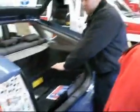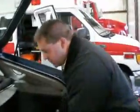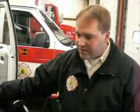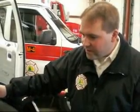Now we'll go to the rear of the vehicle. Normally there's carpet here — I pull the carpet out and pull this panel out. That's the battery pack right there. This metal box contains the battery pack. You never ever want to open that battery pack, you never want to try to overhaul it, you never want to get into it. If you were to get into that, you could potentially be electrocuted — so avoid the battery pack entirely.